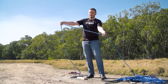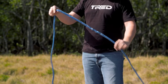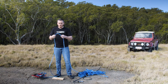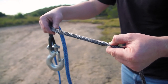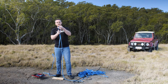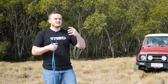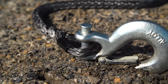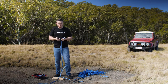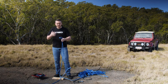That is a trackside, roadside, creekside how-to splice a rope. That's joining a broken rope together. As you can see, that taper has made a clean, progressive finish - it's definitely worth doing. There are so many ropes where the taper is too hard; that soft taper makes a massive difference. Now that we know how to splice two ropes together, it's time to show you how to do an eyelet. You'd want an eyelet to splice around a clevis hook, create your own bridle strap, or make a rope extension strap.